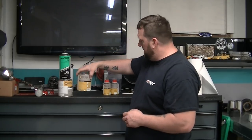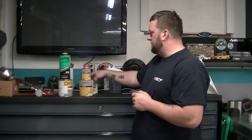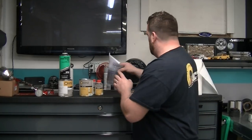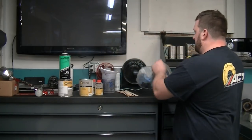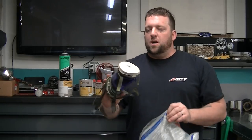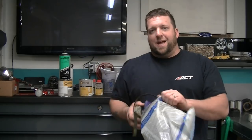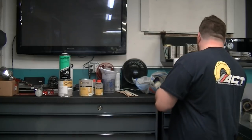Now you're going to need your clear and you're going to need a top coat hardener for that. I have an extra one because this one is almost empty - use the last little bit of it up. You need some mixing cups, some strainers, some paint sticks. You'll also need a mask with new filters. You can buy filter packs cheap. If you spend the money on the mask once, just buy filter packs later. I've had this mask for five years and bought a pack of filters - I think it was like 10 filters on Amazon. Keep a roll of paper towels with you.